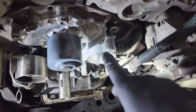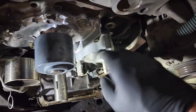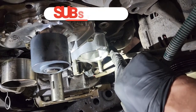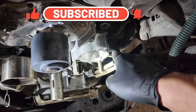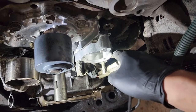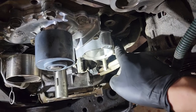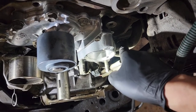So we got the water pump installed, and got this hose for the oil cooler installed. A helpful hint, if these are older hoses, try to get the clamp re-indexed where it was at. Sometimes if you get this indexed where it's not in the same spot it was, it'll end up just trickling out. So it's best to either replace the hose, or if you're reusing the hose, to get the clip re-indexed back to where it was originally at.